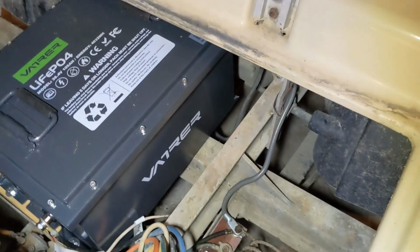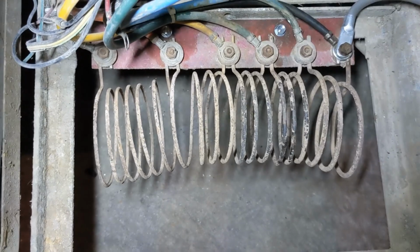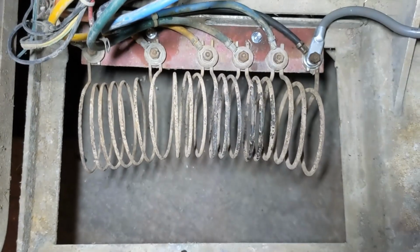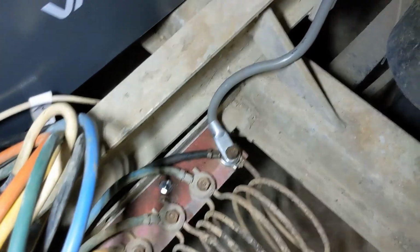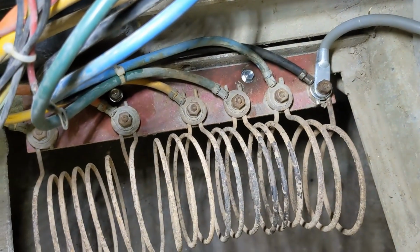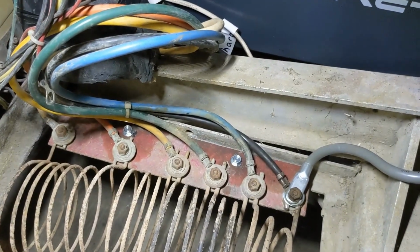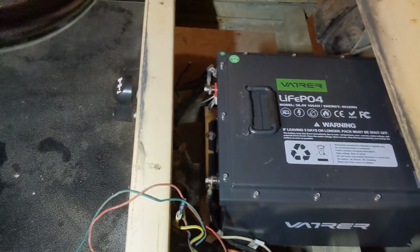That being said, being that it's a toaster cart, I had to move the coils. So here's the resistor coils on this side. Pretty easy, actually. All I had to do was re-drill those 2 holes and just a couple of Tek screws and bang it down into it. Makes it so I can't put anything else on this side. They get so hot that I don't want to risk it. As you can see, I did have to buy 1 cable to get back to the motor. It was too short by moving it, but easy enough to do. I didn't have the materials to make a larger cable, but buy a cable, put it in, done. So make sure those cable wires are far enough off the resistor. I'm going to do a little better cable management for that eventually, but okay, let's see what we got.